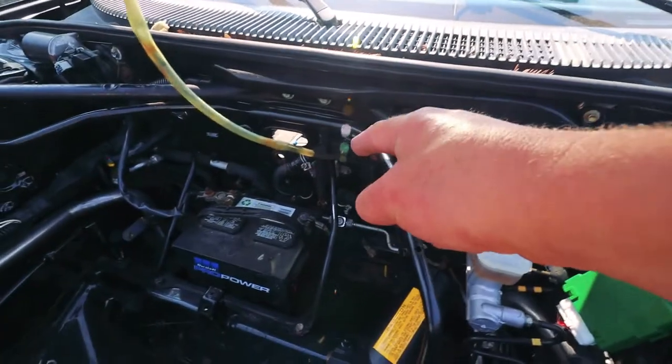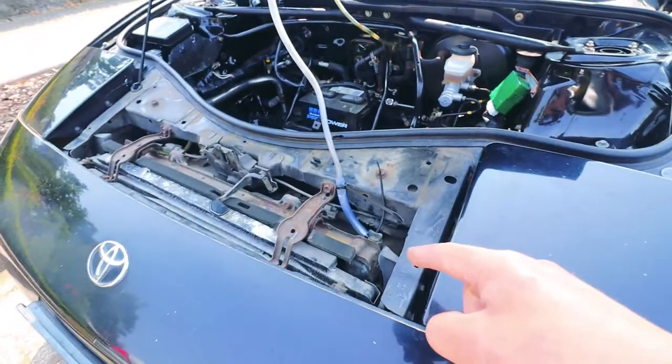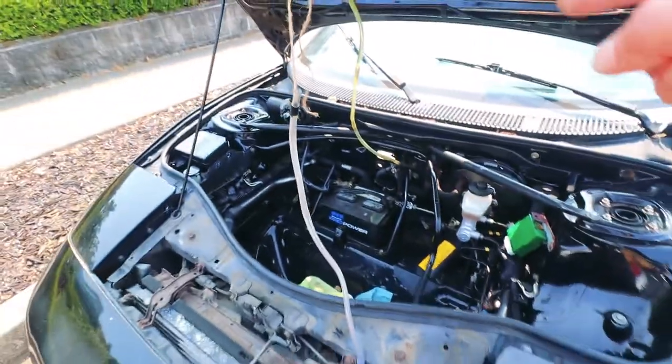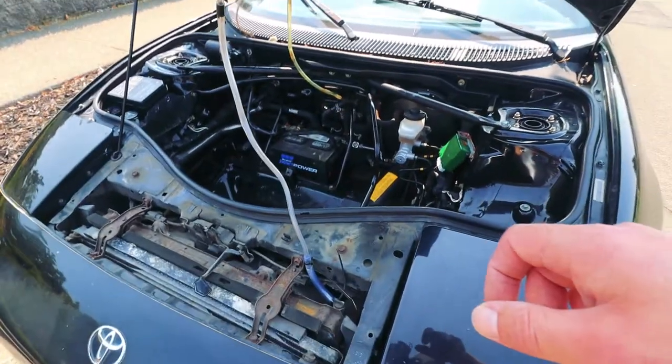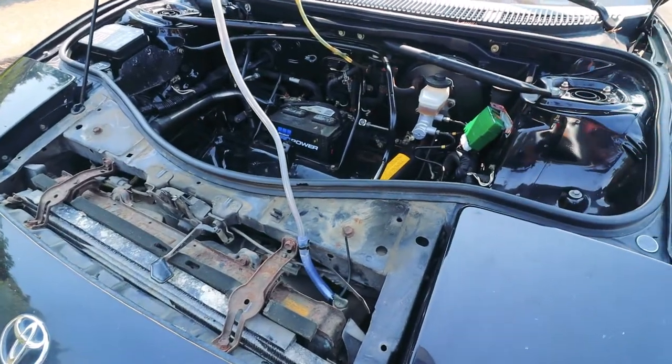There is a service hose already attached to this heater valve. And there is another hose I attached to the radiator. So we got both of them strung up. We'll open up the valves behind them, and then hopefully we'll see some coolant come up and maybe some bubbles if there's some air in there.